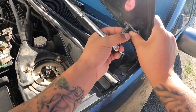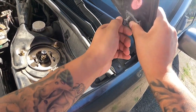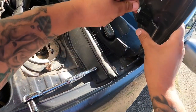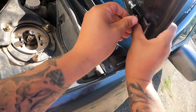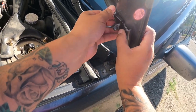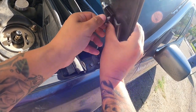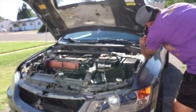The top hood bolt is probably the easier of the two to take off and put back on. You're going to take the bracket and place it with the top part facing inwards, then use the stock hood screw to screw it in by hand first. It's a longer slot opening, so just make sure it's touching the very bottom, scoot it all the way up and in, and you're good to go.